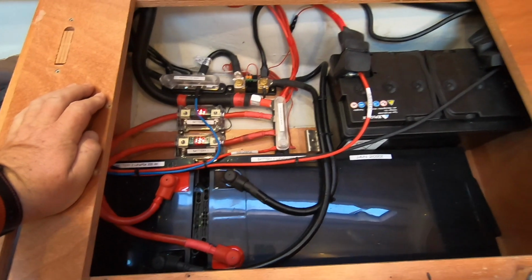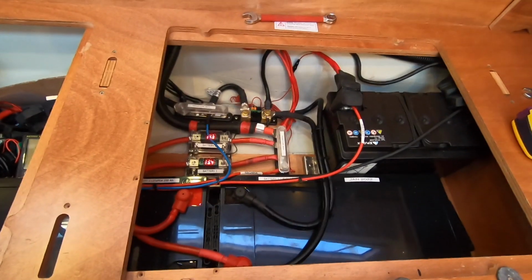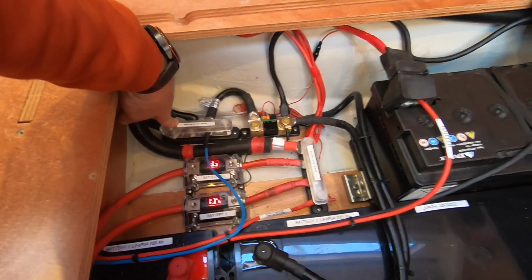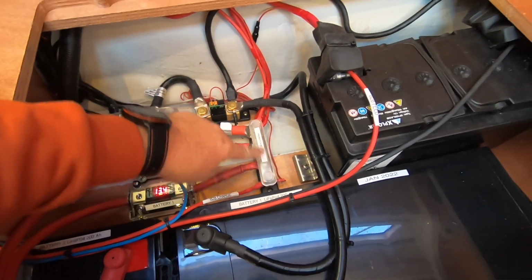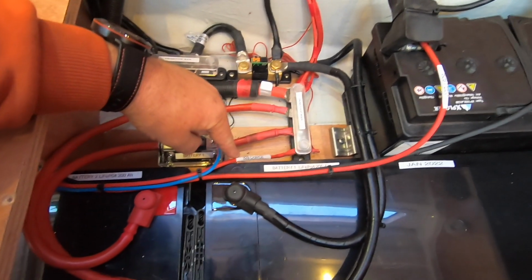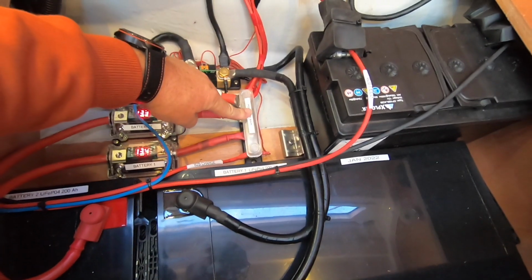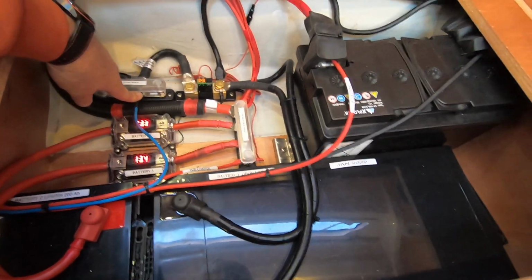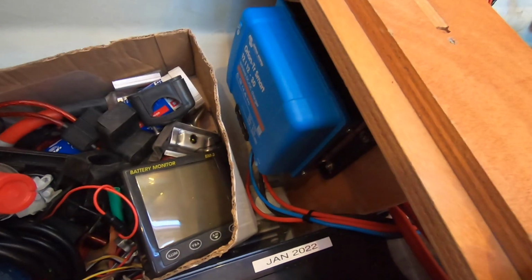A couple of you have been asking in the comments about updates on the lithium batteries. It is finally finished now and all labelled up. So we've put our negative bus bar in there. It's marked up. There's our shunt all in, bolted up. Our positive bus bar marked up. Battery to battery charge line. So that is what charges the lithium back to that bus bar. And the feed, the negative of that is there. The battery to battery feed, which comes that way, goes into the battery to battery charger in there.